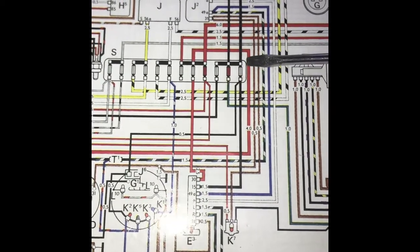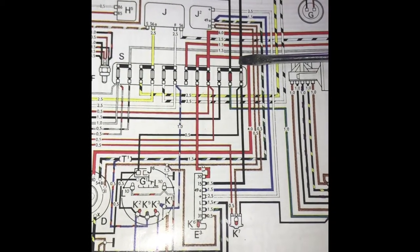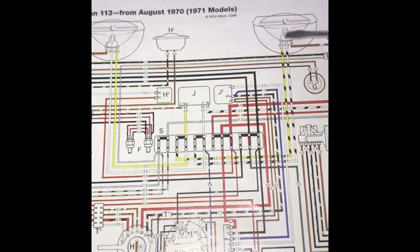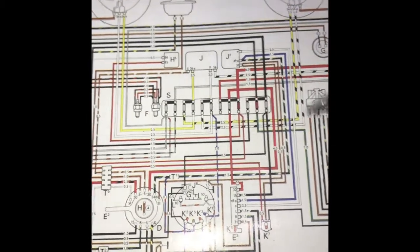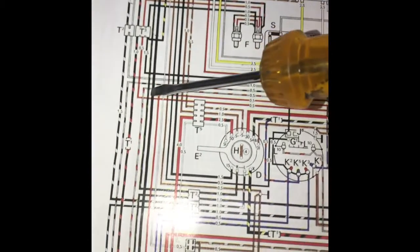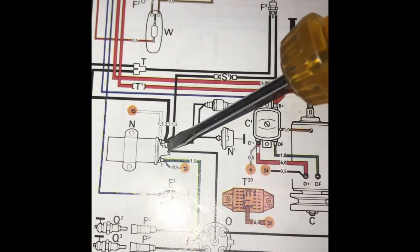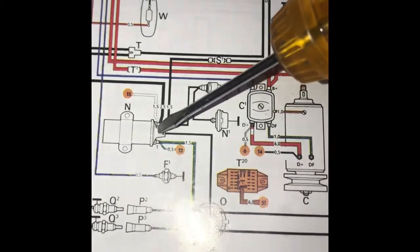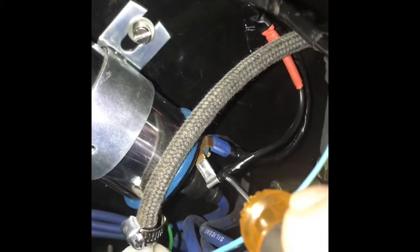If you're looking at the drawing, notice that this is your fuse number 12. That's the black wire coming off fuse number 12 and connecting to the positive terminal in your coil. Notice that these are your headlights, so you will be positioned right here facing this way. This is your black wire — it comes over, down, and connects to the positive terminal for your coil right here. That black wire will be coming through this harness right here, and that wire is going to be this wire that you see right there.